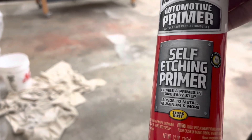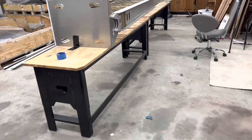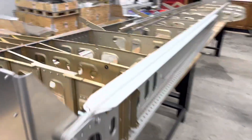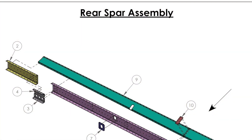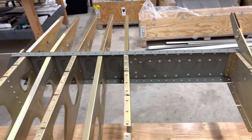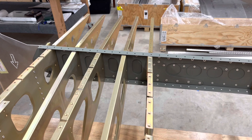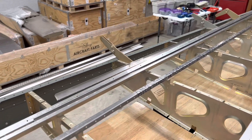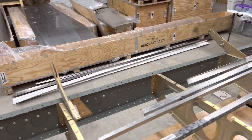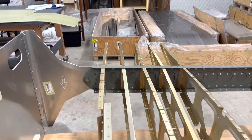I have also primed a couple of parts using just some self-etching primer. I did the trailing edge rib here because I didn't have the time and didn't want to get out all the equipment. It was late at night, so I was able to just prime it in my hangar — threw up a sheet of plastic and primed it so it was dry for the next morning, without having to be out in my yard in the dark trying to paint. That AkzoNobel stuff I showed you is pretty nasty.